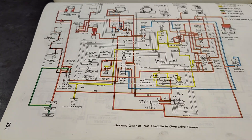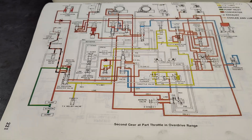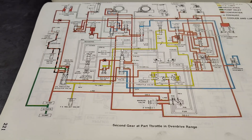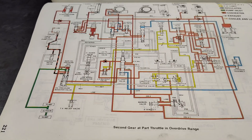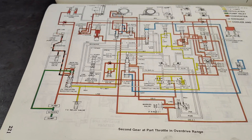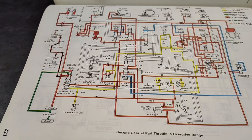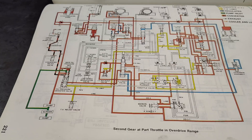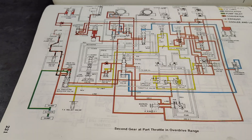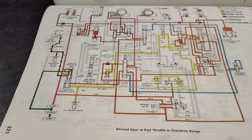I'm not opposed to it. If you want to run it on the street, that's fine, but just understand your shifts and downshifts are going to be more firm than with variable pressure — you don't have as much contrast on that shift feel. But if you've got a high stall converter and like high shift points, then fine. If you feel like you can adjust it but just aren't confident and don't want to burn the unit up, go ahead and run it. Just don't complain when the shifts are firm — you have to accept that part of it.